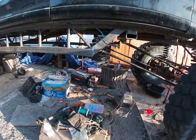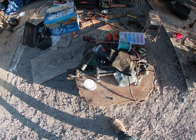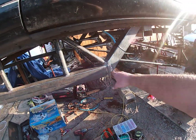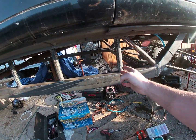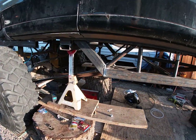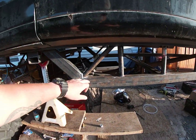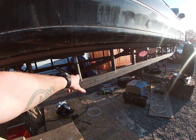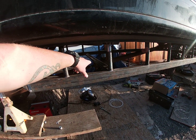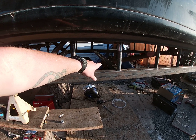I just ordered steering today. I'm doing full hydro steer, which if you can tell, here's my ram. And then my subframe. So it came down here, 45, 45, blocked off, all the way down here. And this is pretty cool. That's mainly completed. It's reinforced on the sides here. I've got the bar across there actually to help reinforce it, and it's also for my carrier bearing drop. Pretty thick piece right there. I think that's more than 1/4 inch thick.